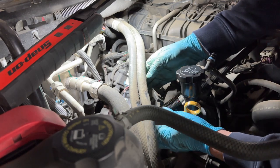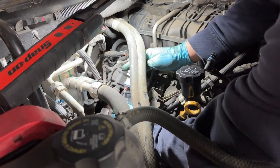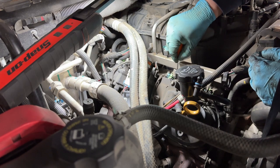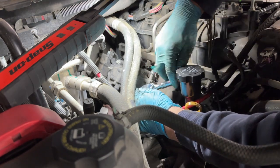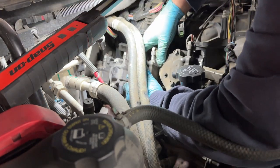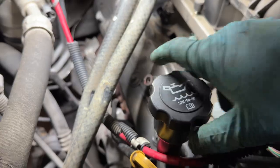Moving on to the right side of the engine, we have two heater hoses that we need to move out of the way. It's the same process as the left side - disconnect the spark plug wires from the bottom, disconnect the harness for the four fuel injectors, then take off the five 10mm bolts holding the coil pack. There is a lot less room on the right side. The main challenge will be the last nut on the back - use a ratcheting wrench and turn it a little bit at a time. Then remove the four 8mm bolts holding the valve cover.